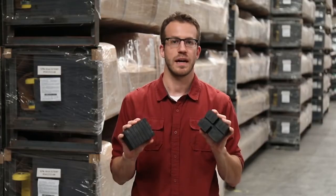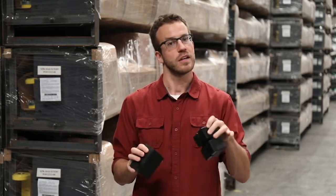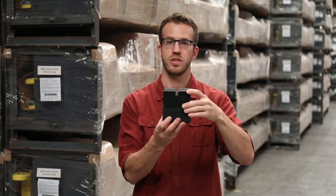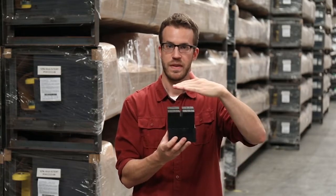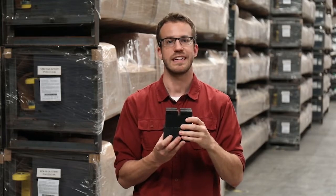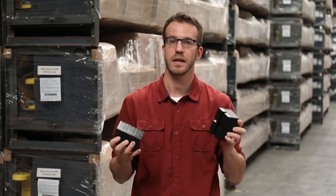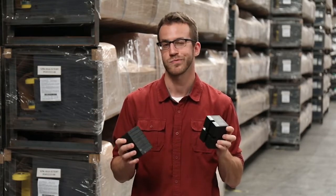The pinch-weld blocks are taller than the small standard blocks, so they work well on their own. You can, however, stack the pinch-weld on top of the rubber block like this, if there's vehicle clearance to do so. I do have to make my little legal pitch, though, to always check the frames are lifting in an even and stable manner from the recommended lift points. Stop immediately if you notice any irregularities, okay?